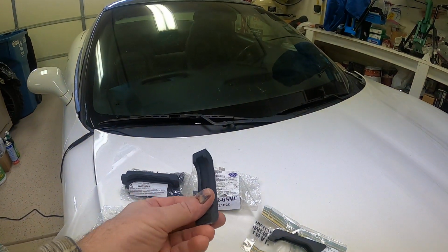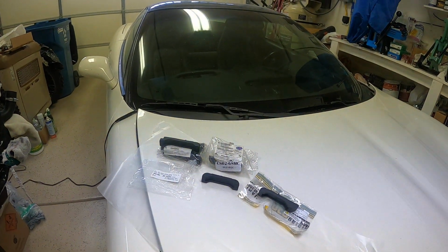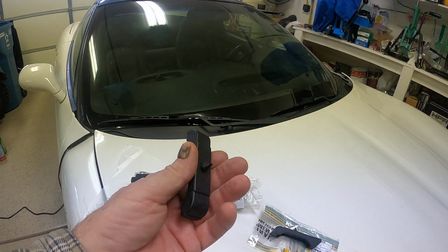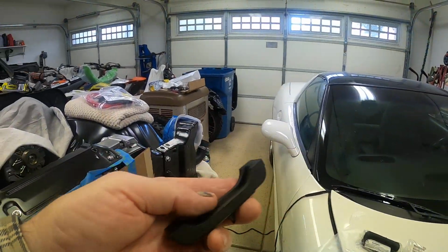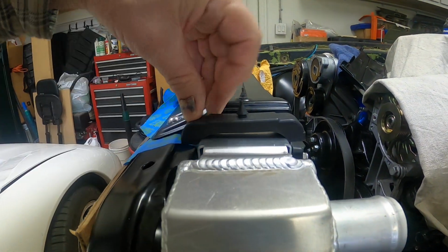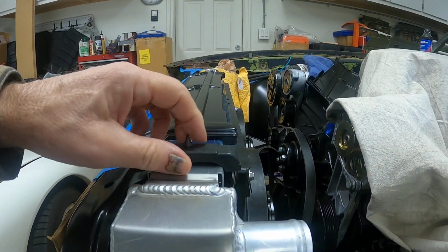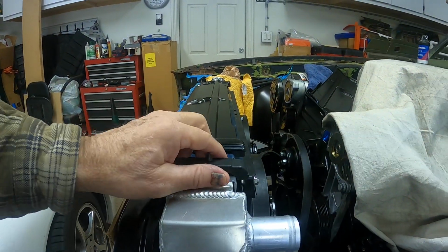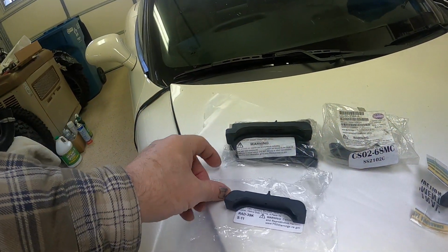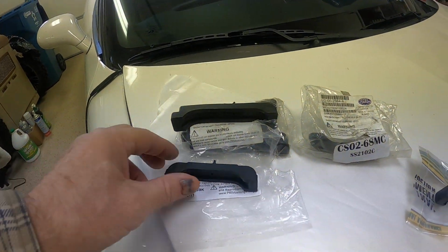And what I did was I took these and put these at the smaller radiator, small block, 6-cylinder, 2-core, whatever location on the core support. And this is still a tight fit on the tank. Didn't quite fit perfect. You can see it's very tight, but I got enough of it in there. The radiator is sitting on enough of it to where it also located the bottom this way. So between these 2 cushions, I got the bottom of the radiator located in there and got it in pretty solid.